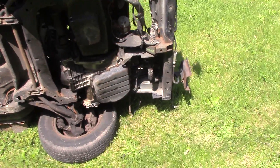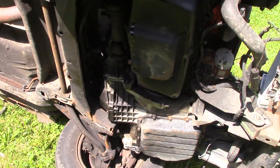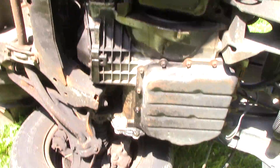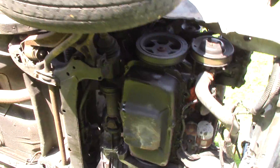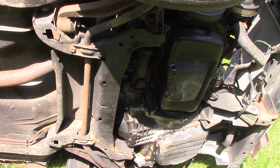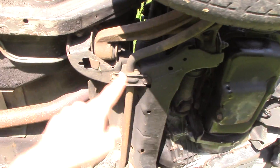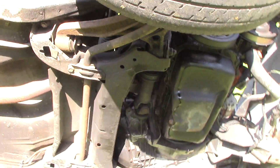Looking at anything else underneath that stands out: I already gutted a lot of the engine compartment. We have the actual CV shafts right here — we're going to inspect all those for damage before doing anything drastic, making sure they're solid and secure, no rips in the boots, no pieces coming apart. There is a little bit of a sub-frame on this car right here; this is what the other cars normally have all the way up front. It's bolted right there, and that's where it ends — really all there is to it, just for the wheel suspension.